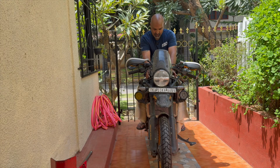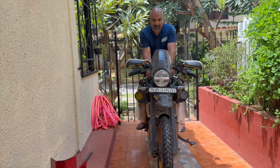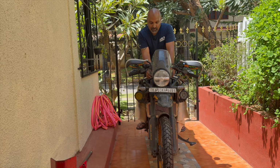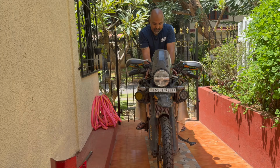So take a look, do a visual inspection. And if at this point things are still not aligning, it still looks twisted, then it could be that something is truly bent, like your forks could be bent or your axle could be bent. It depends on how hard of a fall you had or how hard of a hit you had. So then that'll need further inspection and possible replacement of the part. But if it was just a regular fall or regular hit, then by now everything should be aligned, and now it's time to fasten everything up together.